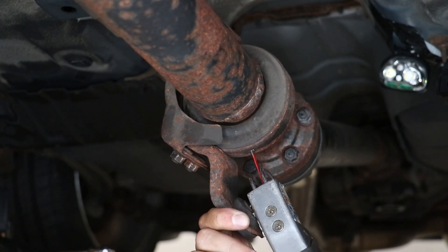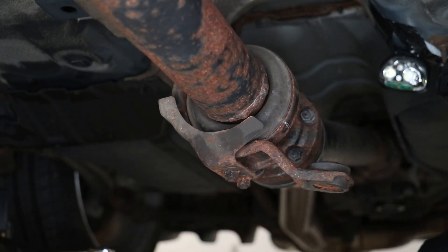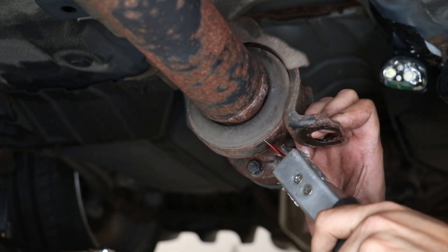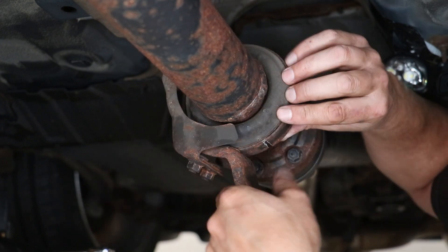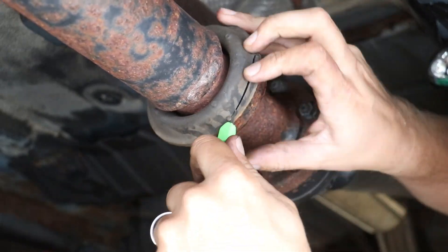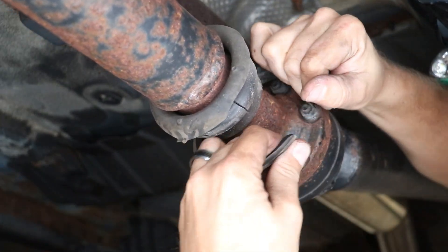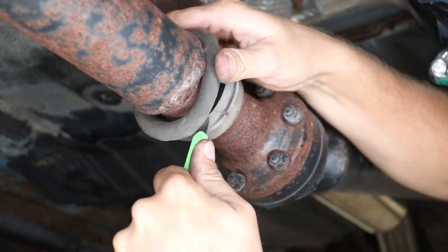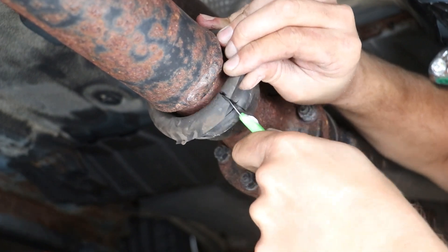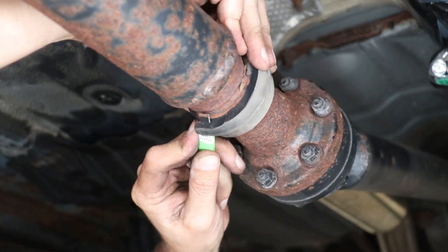First, cut the main frame off. Next, cut the rubber all the way around to remove the inner ring. Now feel around on the bearing to find the soft spot so that we can cut off all the rubber in front of the bearing. Last, trim down the high part to be flush with the lower part.